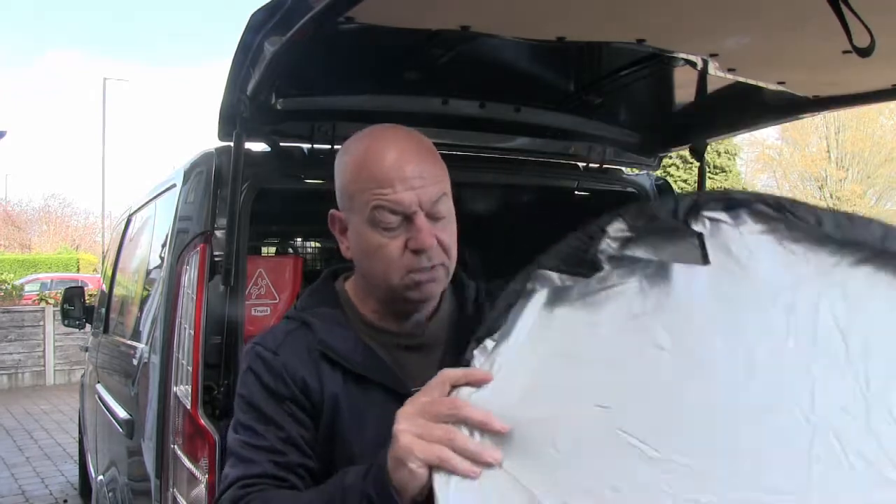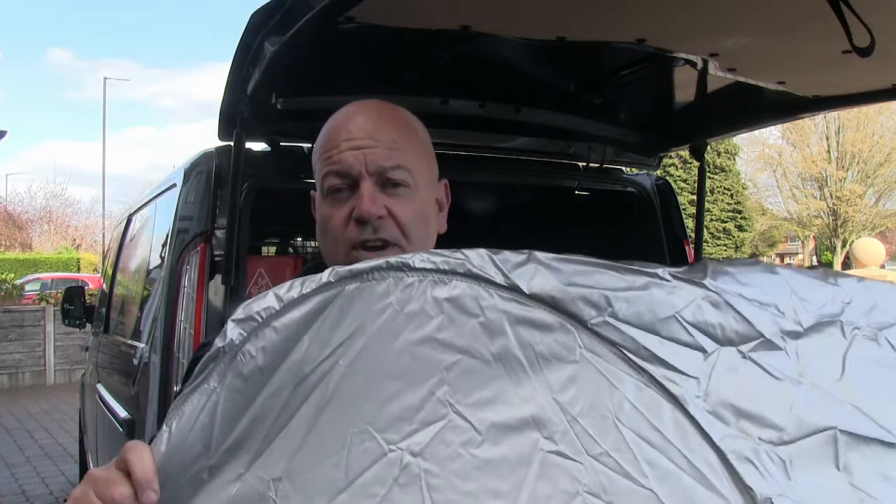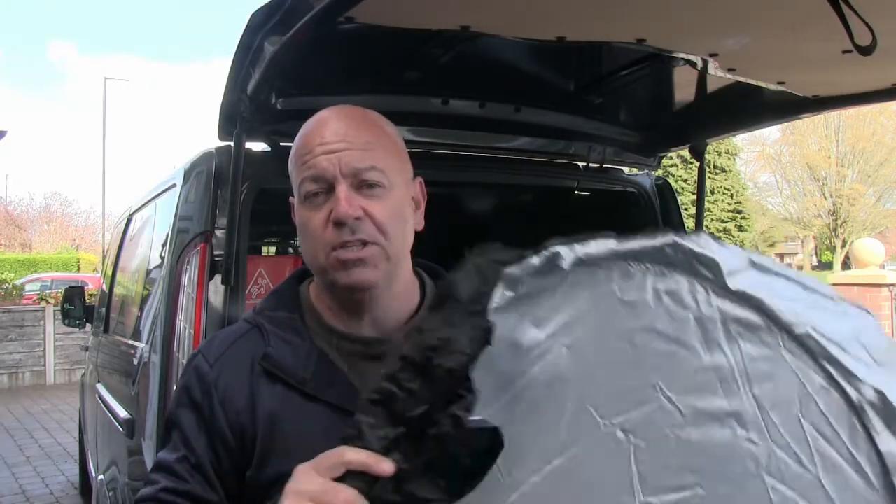The last product in my glass cleaning setup is a windscreen sun visor — the ones on piano wire with reflective material. This is a double one, so it will cover every size of windscreen I do, even vans. The reason I use one is that when it gets really hot, I do the interior first, then put this straight onto the windscreen under the wipers to cool it down as much as possible before I attempt to clean it. A very hot windscreen can be really difficult to get smear-free. I also use these for interiors — when you've got low sun or a really sunny day and you're finding it difficult inside to see what you've done, put this over the windscreen, it darkens the interior and makes it easier to detail.